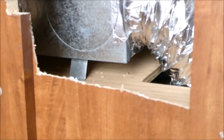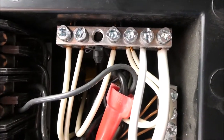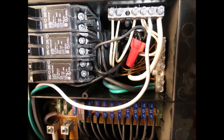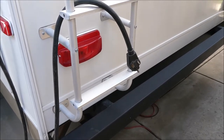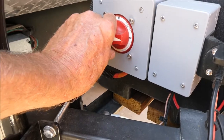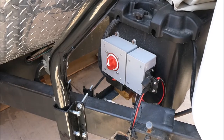This shore power cable that was going into this unit is going to go to the input side of the watchdog over there. So I need to disconnect the cable and move it from back here, behind all this business. I'm going to pull it through to here. The black wire is going to the breaker, the white wire is going to the neutral bus, and the green wire is going to the ground bus. Before we start any of this work, the shore power is disconnected and the battery power to the trailer is now off.